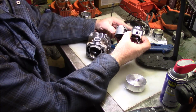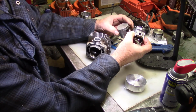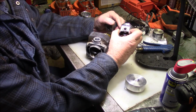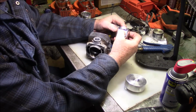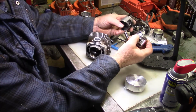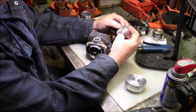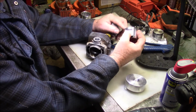That's one of the reasons why the 2 rings is interesting to the production people who worry about warranty. The 1 ring piston is more interesting to the performance guy because it doesn't have to last that long and there's less drag because there's only 1 ring and the piston's usually lighter. So that's a good thing if you're looking for throttle response, you know, and that's a priority. Sometimes even RPMs, that's a priority over longevity.